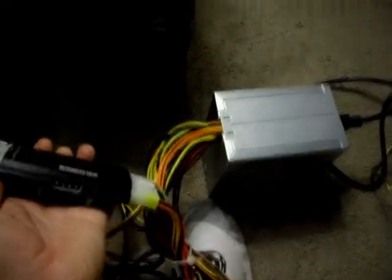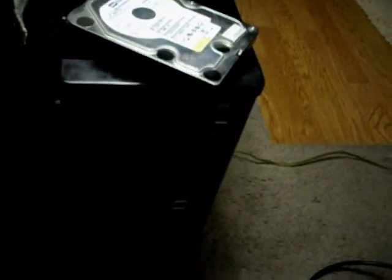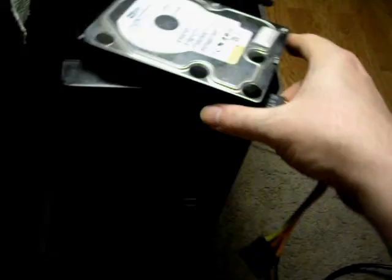You do want to provide a load, and I'm going to provide a load with a hard drive that came in this computer. This is a SATA drive, so I'm going to take one of my SATA cables and plug it in. Excuse my camera work while I try to do everything one-handed here. I've got the power going to the hard drive — I should feel it spinning when I power it on, and that's going to provide my load. As you can see the cable is coming from this power supply.